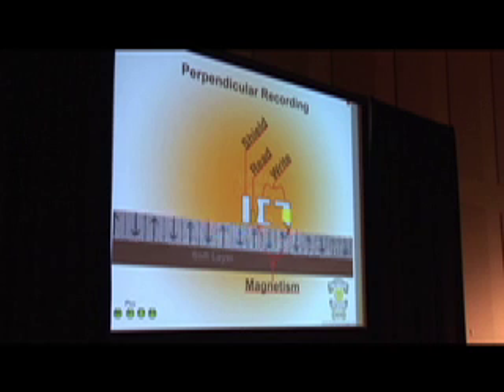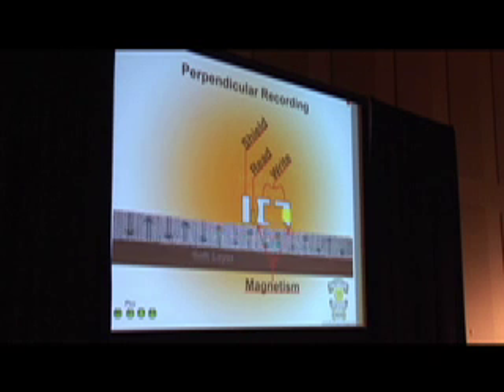This new technology that they patented — the day I released this presentation — is called HAMR, H-A-M-R: Heat Assisted Magnetic Recording. As the head goes across the platter in this new technology, it zaps it with a laser, which causes the lubrication on top of the drive to evaporate. They came up with the idea of using a reservoir inside the hard drive to create a vapor and have it go back to the platters to restore lubrication while it's running.